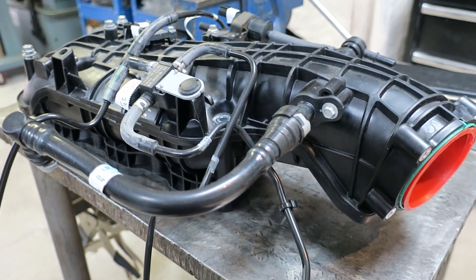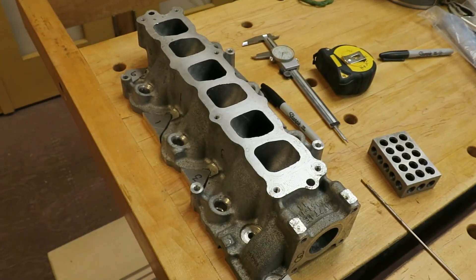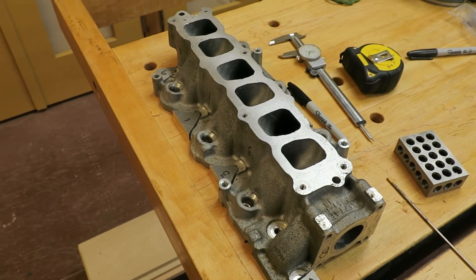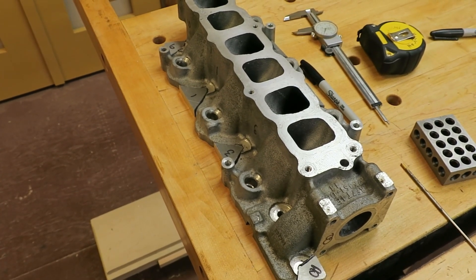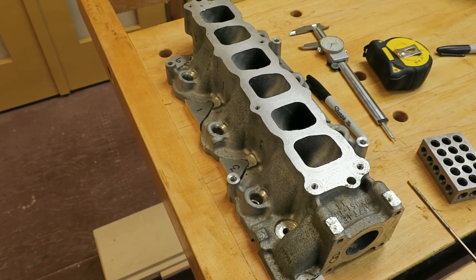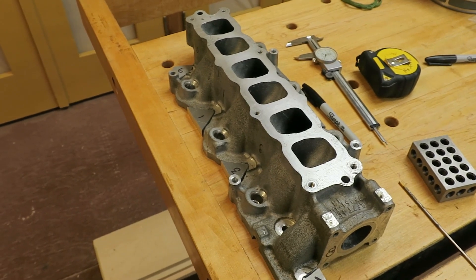So I decided I was going to make the replacement out of metal instead. This is a lower intake manifold off a 2010 Lincoln V6 — it's set up for port injection. I wanted to change over the EcoBoost to port injection because the ECU to drive the direct injectors was going to be pretty expensive unless I bought the Ford street rod package. I want to go with a standalone ECU instead — it's more flexible for programming.